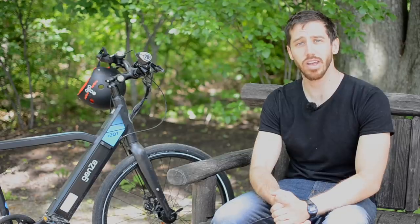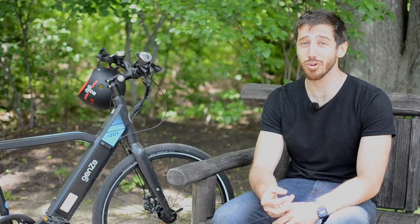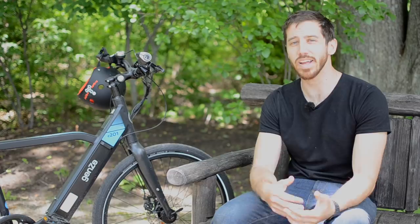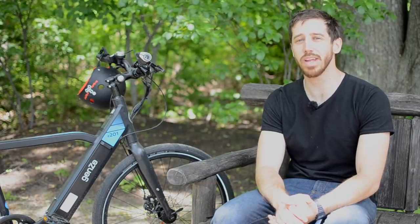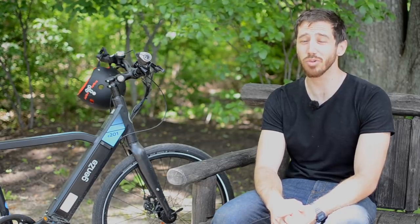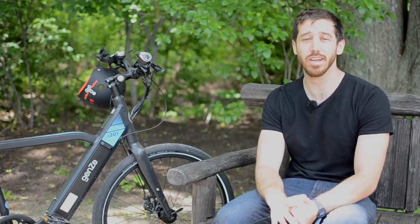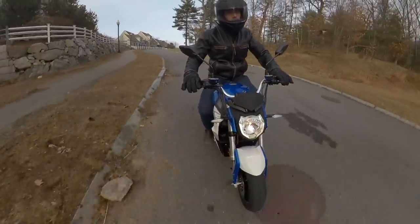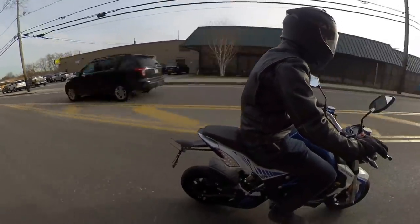The last group is the 1500 watt motors. Whether you're looking at a hub motor or a mid drive, 1500 watts is going to carry just about anybody up some pretty big hills and it's going to have really nice power off the line. At 1500 watts you're starting to get into the realm of light electric motorcycles. Obviously motorcycles are going to have a lot more power, but at 1500 watts you're really out of bicycle territory. Pretty much no matter your weight, unless you're morbidly obese, a 1500 watt bike is going to carry most people up significant hills and give you thrilling seat-of-the-pants acceleration where you twist the throttle and you're just kind of hanging on as it takes off. Above 1500 watts you've really entered light electric motorcycle territory — my City Slicker electric motorcycle has a 3 kilowatt continuous, 4 kilowatt peak mid drive motor. So the most you're going to see is around 1000 to 1500 watts for high power electric bicycle motors, whether hub drive or mid drive.